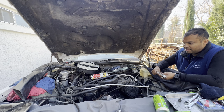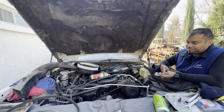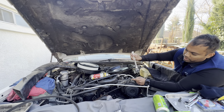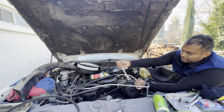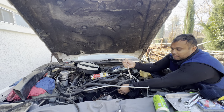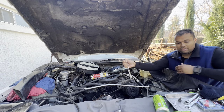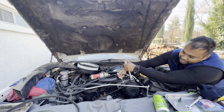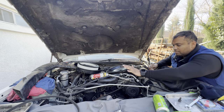This is kind of an old method. Usually you have a belt and a tensioner that's spring loaded, but this is older. Being by myself, this is kind of difficult. I have my half-inch drive ratchet here — I'll put this in the square right here and position it where I can pull it towards me. I have to make sure I have enough tension on the belt, enough to where I can turn it but not yank it to where it has no slack. I'll grab my 15 ratchet wrench and start to tighten. I'll do a time-lapse so you can see what I've got going on.